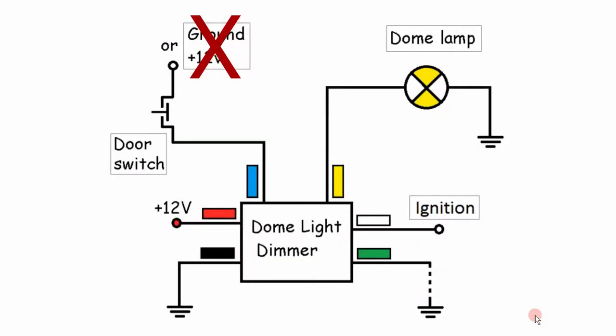All right, in an effort to make this a little clearer, I've broken out the schematic. Sorry if this gets a little dry, but I wanted to make sure that everyone understood what I was talking about on the vehicle. So that wiring loom bundle that I referred to is in the engine bay. It's behind the coil, the ignition coil. There's a bunch of bullet connectors on this wiring bundle, and the firewall side is the top side, the side that goes into the wiring loom and then into the car. The other side goes down under the vehicle.